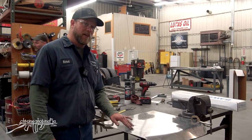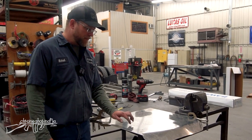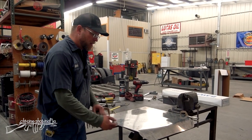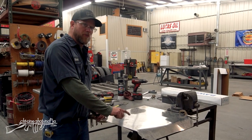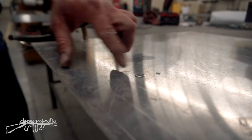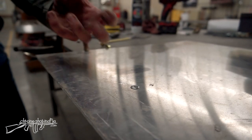When I was talking about taking the hucks out of the visor brackets — that truck did not have any, it was actually bolted. But this is a huck fastener right here. It's got a collar on the backside that's crimped in there. There's no removing this with a saw cut or anything. So what we have to do on a situation like that is cut this huck out from the top. I'm going to take my die grinder and grind the head down a little ways. I don't want to get too close because on a fiberglass roof cap, for example, that would start to melt the fiberglass.